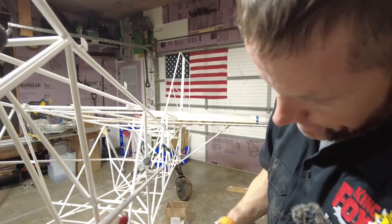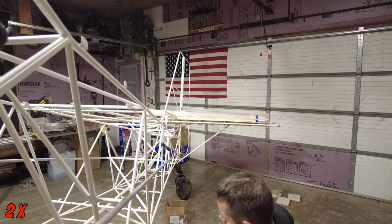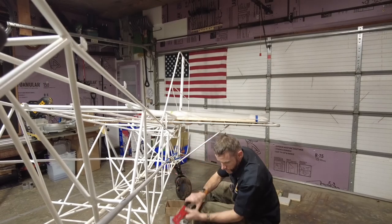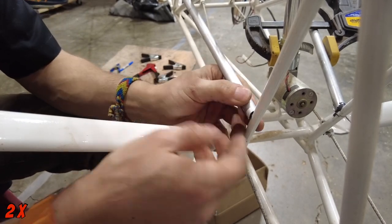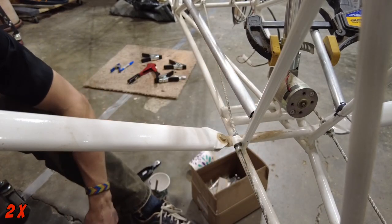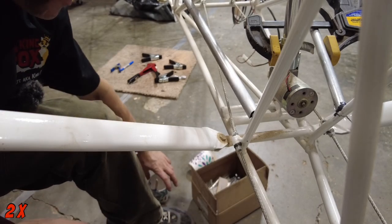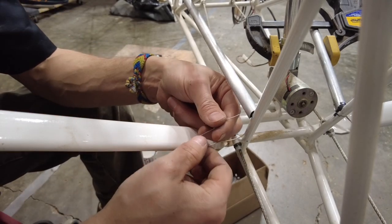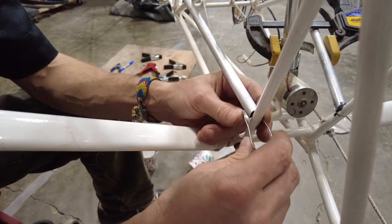Bring this piece up over the top, bring it right back down so it sits on the framing member like so. It looks still a little bit higher than the other side, but at this point I can't take it off without drilling out my rivets, so it's going to stay put. I'm going to hit it with the safety wire and then epoxy. The wire's going through the holes and around the back.